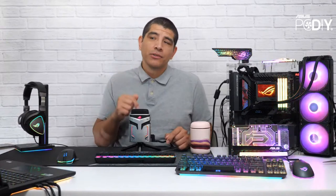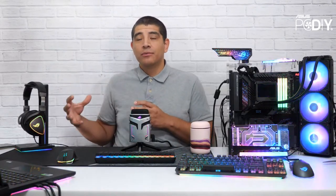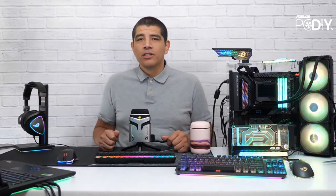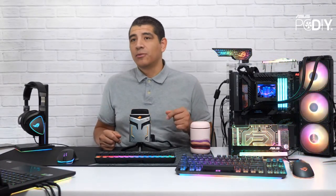It looks absolutely awesome. One of the really cool things included within the NVIDIA driver update is that we continually work with NVIDIA to see if we can have certain monitors added into the formal GeForce G-Sync compatible application. Essentially, when the driver installs and detects that monitor through the EDID information, it can help ensure a good experience when enabling adaptive sync, or essentially G-Sync. There are a lot of extra steps to be formalized as a G-Sync compatible display, and this also includes elements within the driver. Some monitors might not list G-Sync compatibility on the product page originally, but through a later driver update we can update them to support G-Sync.